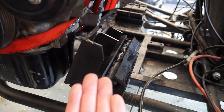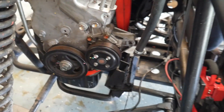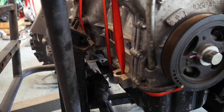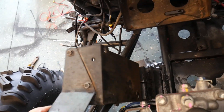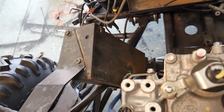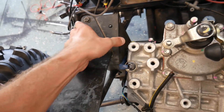You can see this lines up pretty well where it's at, but this doesn't give me enough clearance for the rear axle — the rear axle is hiding behind this other engine bracket. So rather than modifying all of them, what I'm going to do is cut this engine mount back here and move it about one inch towards the camera and about two and a half inches backwards. That should tuck the engine into place and still give me plenty of clearance behind the seat for water hoses. And if I slide this back just a little bit, you can see where that spline is for the axle to connect. On the far end, there was a vertical mount that came all the way up here, and I'm going to try to pull the engine over far enough to keep this in position and just hang some kind of vertical bracket off of those two bolt holes.